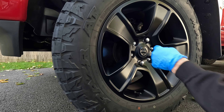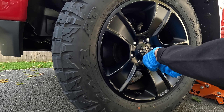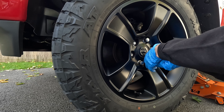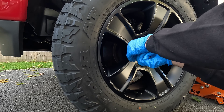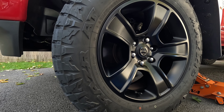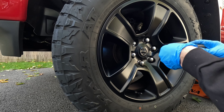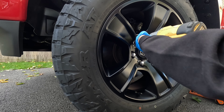I'm going to bend the rules a little bit. The torque spec on the truck is 130, but that's for the factory studs - that tells me that these studs are a little bit softer, hence the lower torque spec. So I'm going to go 115 foot-pounds. I know people that do the full 130 and they haven't had any issues, but I kind of like to follow the rules just a little bit. So 115 - a little bit lower than factory, a little bit higher than what KSP calls for. Whatever you guys want to do is up to you, this is just how I'm going to do it.